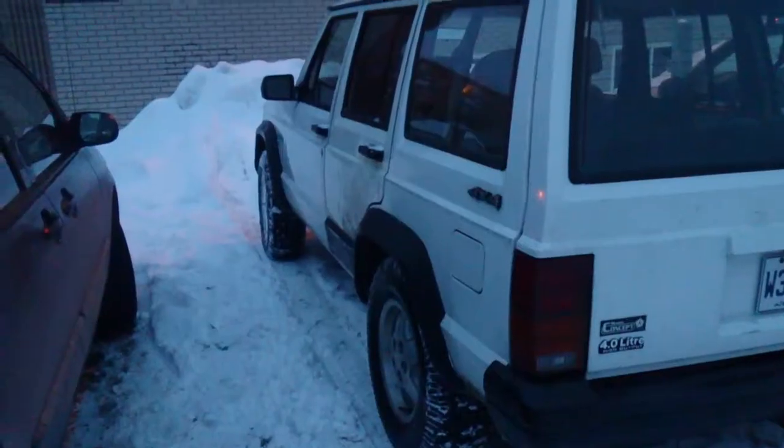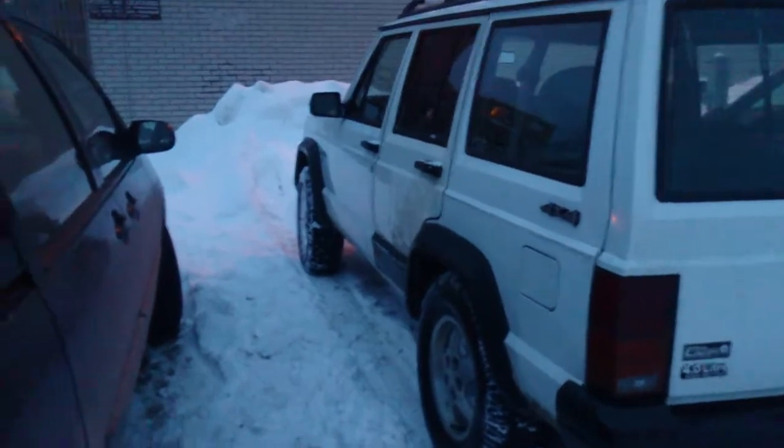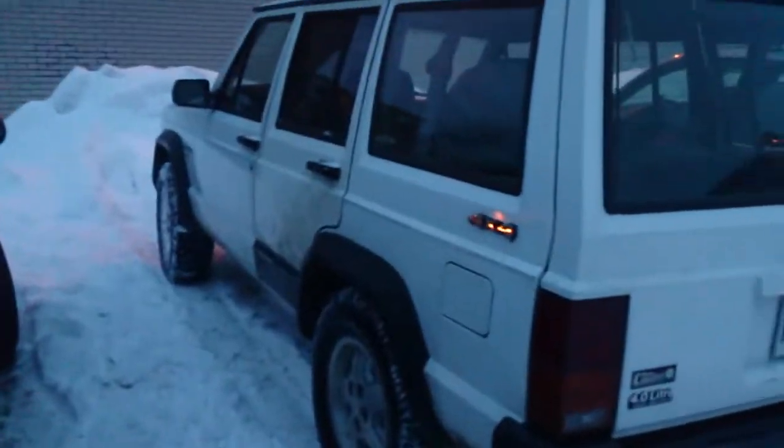Alright. So this is what came out. I had one side that didn't even have a bushing. This is the bushing from the other side. There's a neighbor's crazy dog. And there are the new ones. Installed. Ready to go. Alright, just took it for a little test drive, and no more ka-clunk, ka-clunk.